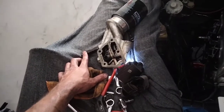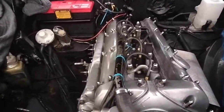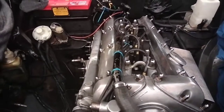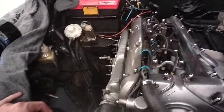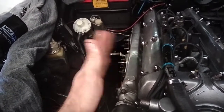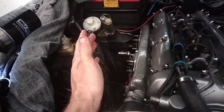A little bit concerning, because I yoloed it when I was down in Sydney. I thought, okay, the absolute worst that this could be is that I've damaged all the main bearings in the engine. It still sounds great — there's nothing wrong with it. I thought, at the very worst I can replace all the main bearings, and that will be cheaper than a tow back to Brisbane. So I yoloed it all the way back, operating at about 20 psi the whole way. The reason I thought straight away oil pressure relief valve is because the moment you give it revs it comes straight up, but then the moment you back off it goes to zero, or close to zero — two or three psi. That's classic oil pressure relief valve symptoms.